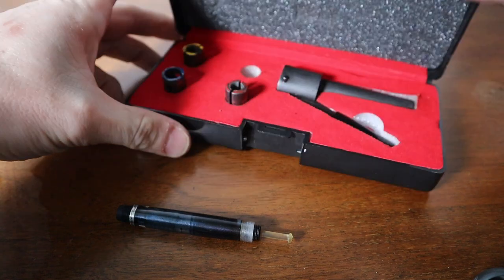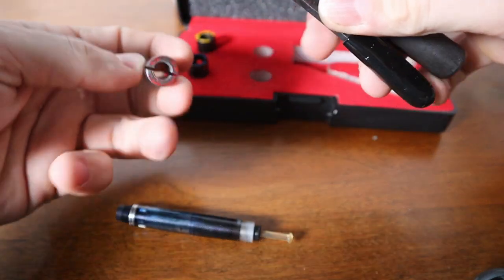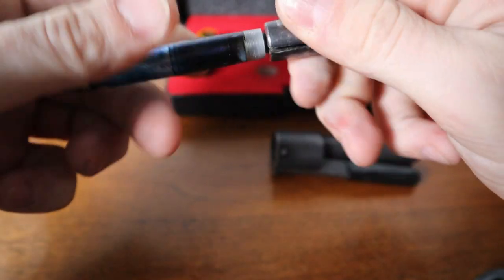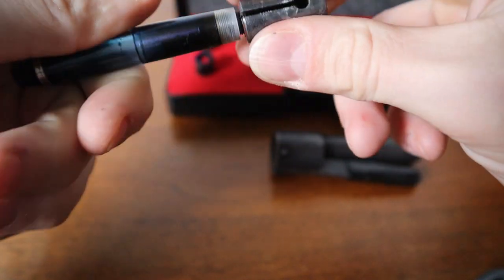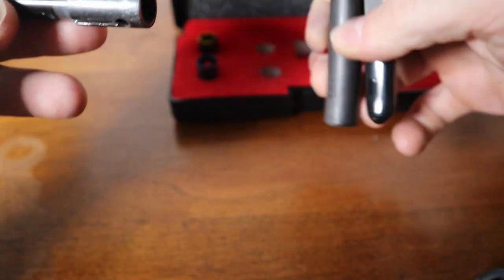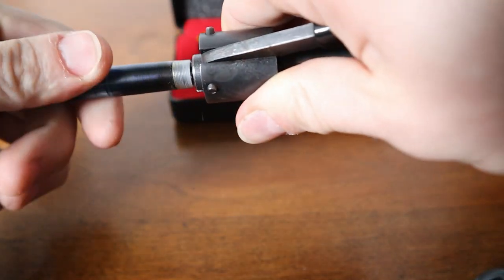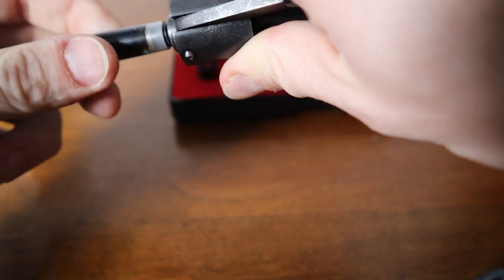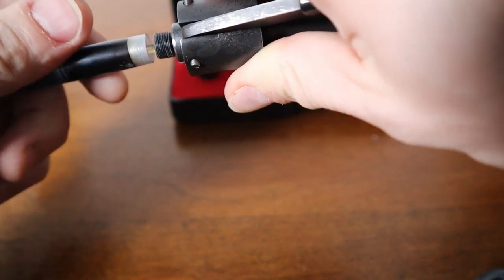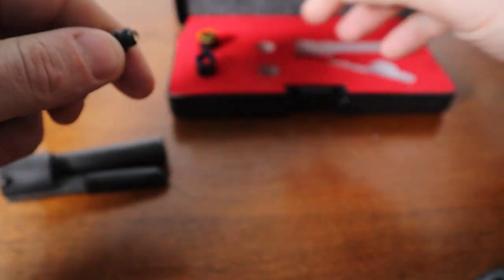And we'll get the Vacumatic tool that I have, get the compression wrench, the red end of it. We'll get it down here. Make sure that threads correctly. There we go. And let's see. There we go. Usually don't have to put heat, so that was good. This one did feel pretty springy, so let's actually see if there was an intact diaphragm on this one.